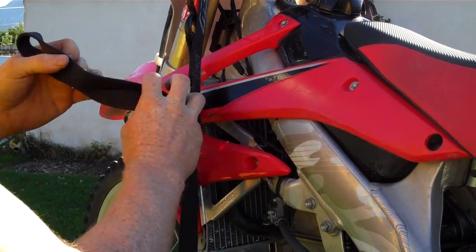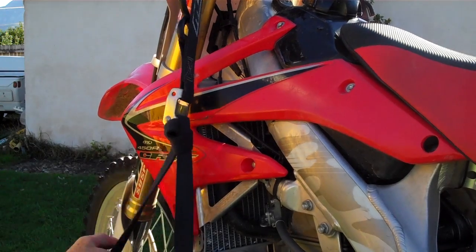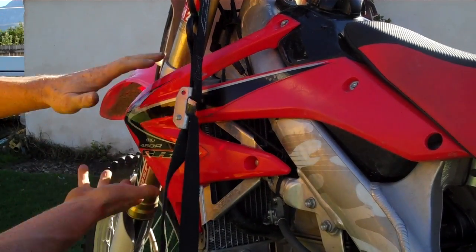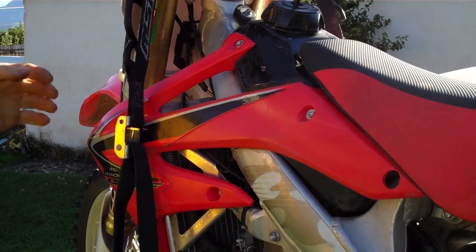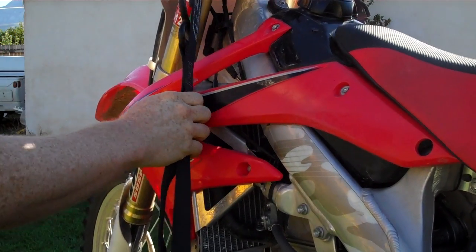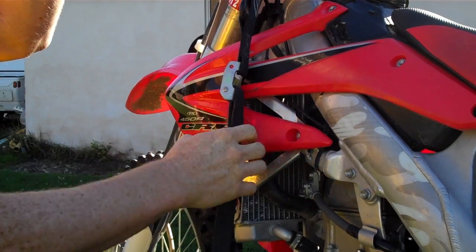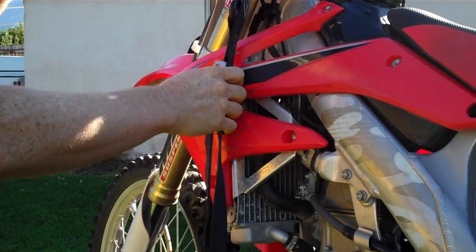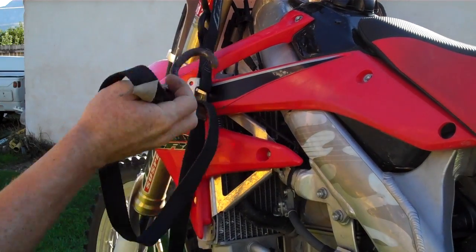You may not have experienced these come loose, but I've had bikes nearly fall off the trailer because of this not being done. What happens is you have a front suspension that will collapse and expand, and when the strap gets loose all kinds of things can happen. Ultimately when the suspension snaps back it bites and frays the strap, and once it's loosened the hooks can come out from underneath — and then you're done.